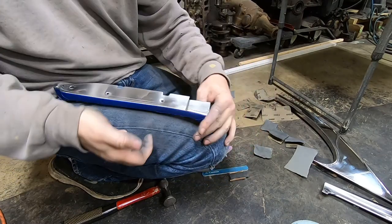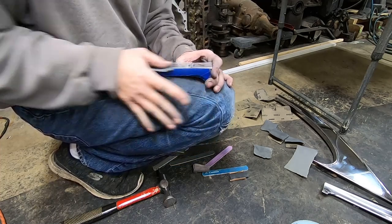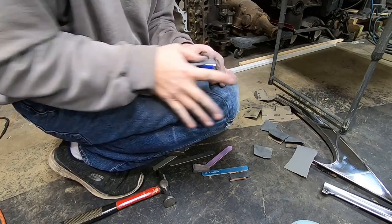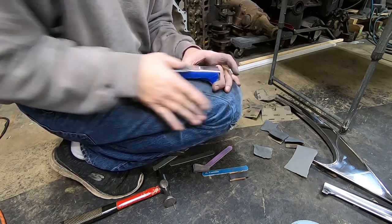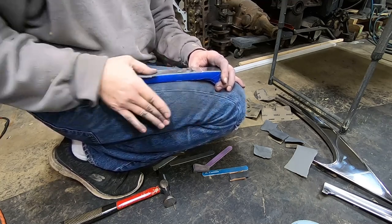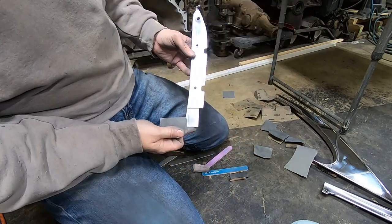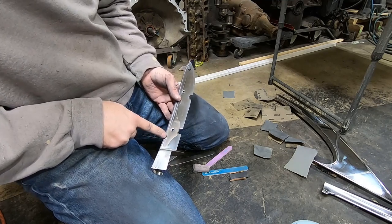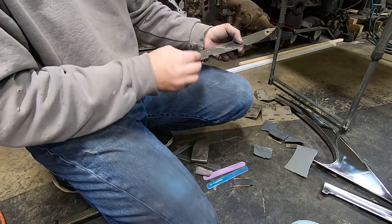Find out that the compressor shut back off. All right, so I've got 1500 grit paper here, dry, going one direction. Way better. There's a little dent right there I probably missed when I was hammering and dollying, but it doesn't have the big dents in it now, at least. It looks way better.